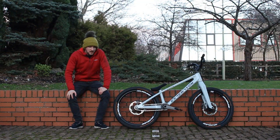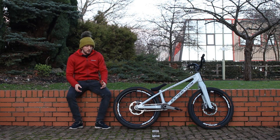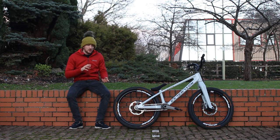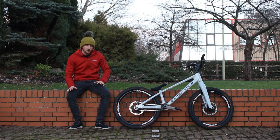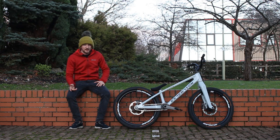The cranks — they're extension prototype cranks. They're CNC'd out of solid aluminium billets and then anodized black. They're very stiff, haven't had any flexing with them. They go through a BB30 bottom bracket. You need the slightly larger bottom bracket, especially on a carbon frame, because it reduces the point loads and spreads the load around a larger diameter. That came with the frame, and when the frame kits come out they'll come with the BB and the headset as well.